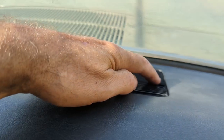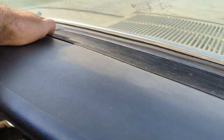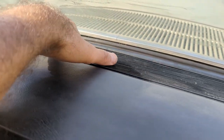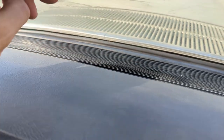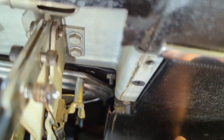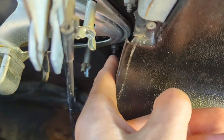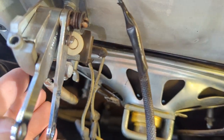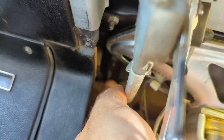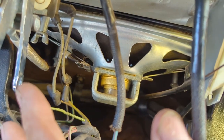There's a Phillips screw on this side and a Phillips screw on that side. Now don't start prying on it, because there are four bolt studs that go down underneath where the speaker goes. You can see one of those studs right there, one back there - they're not the speaker studs, these are separate studs near the speaker. There's another one there, and there's the other one. You don't have to take the speaker out to do this.